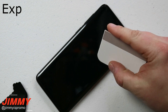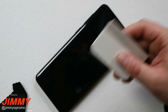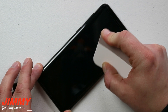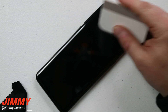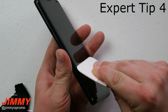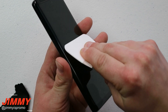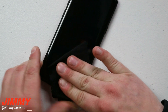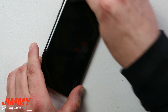A trick for small isolated bubbles in the middle or away from corners: take the edge of the hard side of the squeegee and push down really hard on just that isolated area, going back and forth. The adhesive is almost like a gel that you can work the bubble out of. The angle you want is way down low pushing outward — not straight up, not sideways. After about four minutes of pushing out bubbles, including lifting one corner about three times, the result is looking good.